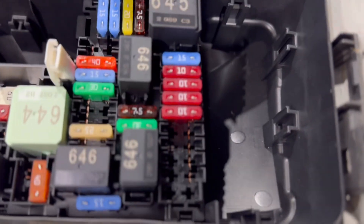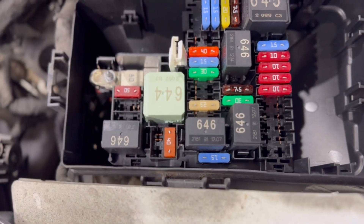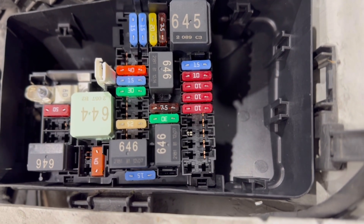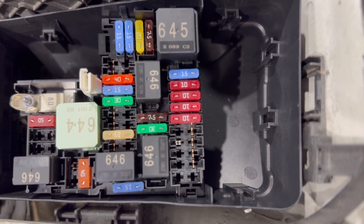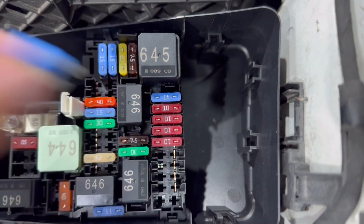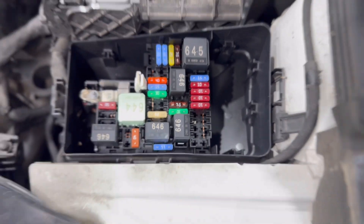I did just go ahead and pull the fuse. Started the car and ran it out of fuel so we don't have any fuel in the lines. It is that one - you can see the silver terminal on it. I'll place it in its spot just like so. Just pull it out, run the car for a few seconds, car will then die because you don't have any fuel, and then you're good to go.